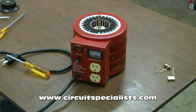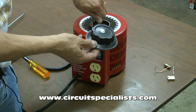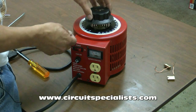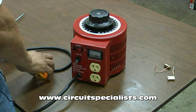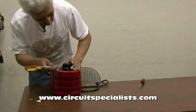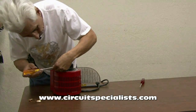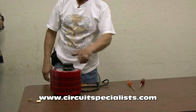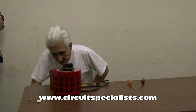Now I think it's on secure and I can go ahead and reinstall the knob. We're going to make sure that the arrow on the knob is pointing to the right location, so I'll take it all the way to the zero point and put it on. Notice that because of the flat side here it's pretty much going to fit the right way. Once the arrow is in about the right location I'll tighten up my set screws. And we're done and ready for lots more hours of operation of the variac.